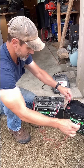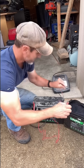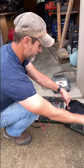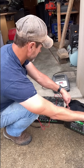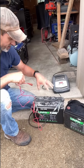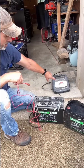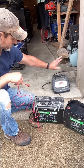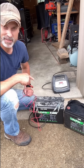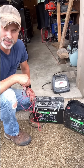This will let the charger start charging. I've got to make sure I touch the right side to the right side. I'm going to just touch these for just a minute — and now it started charging. It read enough voltage that it said it was safe to charge, and now my standard automotive charger will charge this up just like that. You don't have to buy a new battery if this happens — you just have to jumpstart your lithium battery.